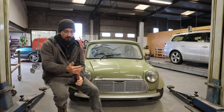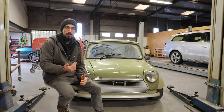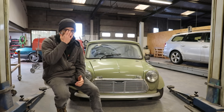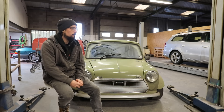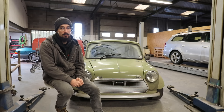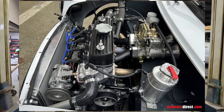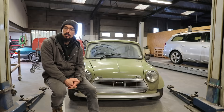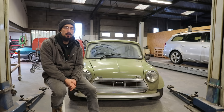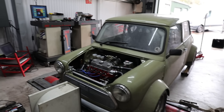Interestingly, when he went all the way down to the two and a half inch manifold, the car went really lean and he had to jet it back up to compensate for that. So obviously it was running really rich with my manifold on there, and the sweet spot was the three and a half inch one. And if you look at pretty much every other example of the Miglia cars that run these engines, they all seem to run the three and a half inch manifold. With the three and a half inch manifold on there, it sounded different straight away — revving it from low RPM, it just seemed happier for sure.